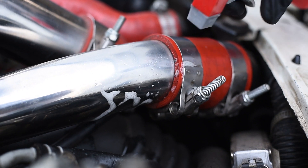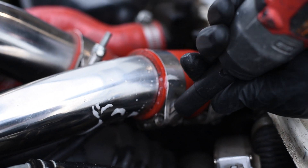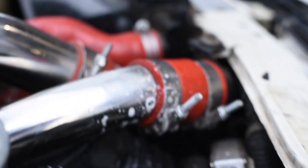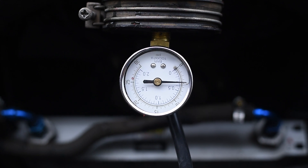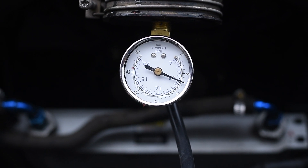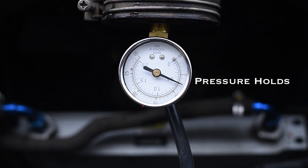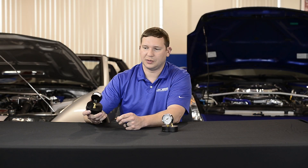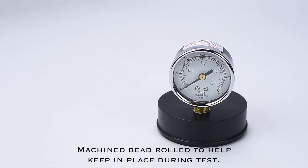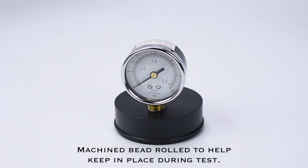Generally with safe results. As you saw in the video of our guys in the shop, you may have noticed they had a hose attached to their tester. Conventionally they come with a Schrader valve installed like a tire valve — but with the large volume of the system, it's time consuming to fill up. So our guys will remove the valve core and pass a hose over the Schrader's housing, zip tie it, and run it straight to a blow gun on shop air. Zip tie that with a little bit of room to work around — saves time and makes you more efficient.